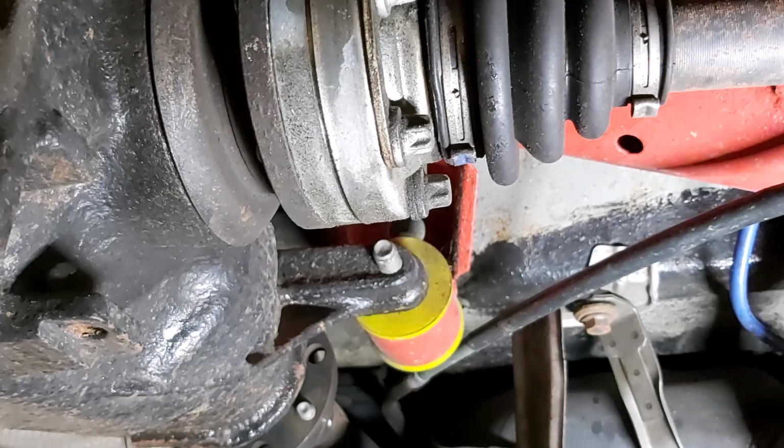Just want to drop a quick note in here. I did decide that I would put new bolts in both these output drive flanges and the prop shaft flange. The only problem is that they may not arrive in time, so I may still have to use the second-hand bolts, but really I'd go for new ones if I were you.